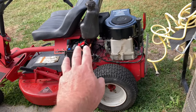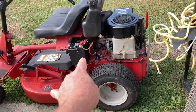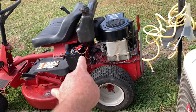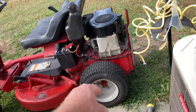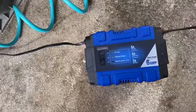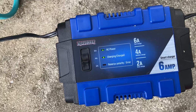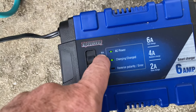If it's an older battery it might take two to three hours. If the battery is completely dead, using two amps will take about one to two days depending on the condition of the battery. If you have an old battery and want to charge it within six to eight hours, you can use the six amp setting.